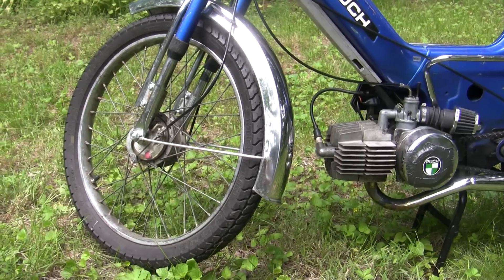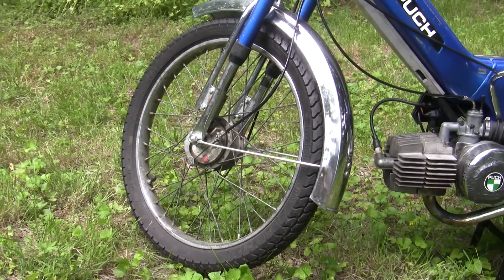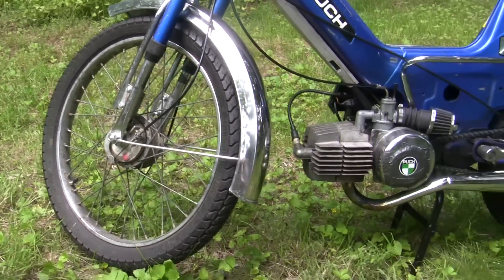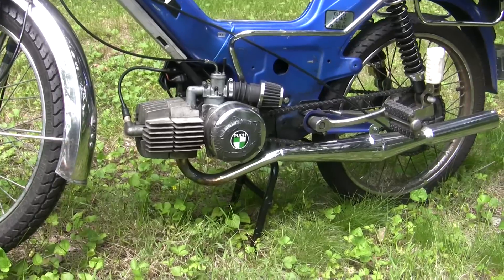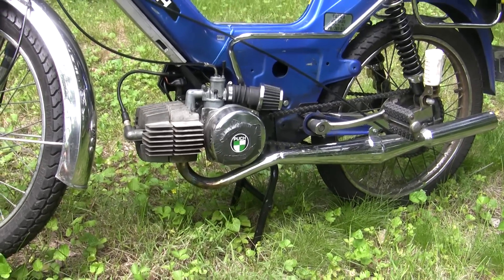There are a lot of reasons to go to performance parts. For example, if you get a heavy tire like the Michelin Gazelle, you'll lose about two miles an hour because of the rotational weight — fantastic tires, but very heavy. So let's say you go out and get just a basic performance pipe like a Technobullet, Boss, or Bi-Turbo. Now you just need to decide what jet you need.